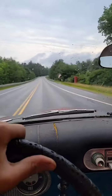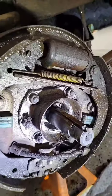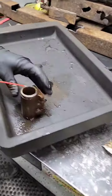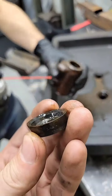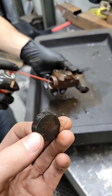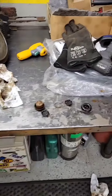This wheel cylinder finally came apart — it was super gross — but the seals actually look like they're kind of fine. So we might be able to just clean this up, get all the gunk and the rust out of it, put it back together, and call it macaroni.